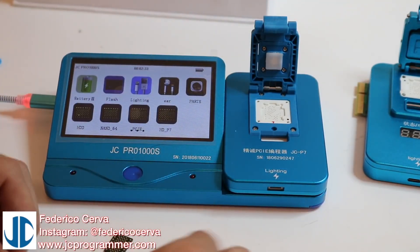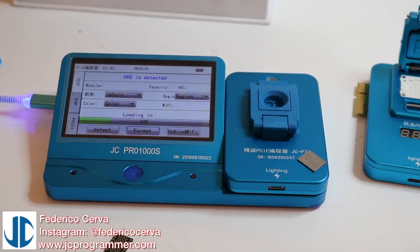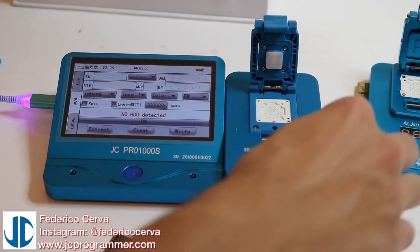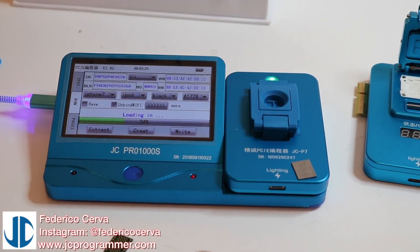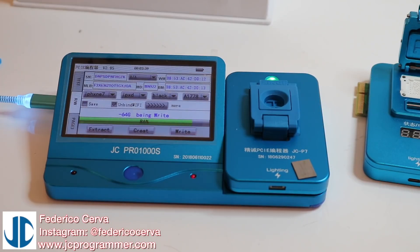Let's put in another NAND. This is the one with the good info, and here's another one - I'm not too sure on the size, let's just check. It's very fast compared to this - this is loading and detecting. Technically this is a 64GB. We can format it. If we wanted to upgrade this 32 to a 64, we put in the original NAND, extract the data, and then we're going to transfer it to the actual 64GB.